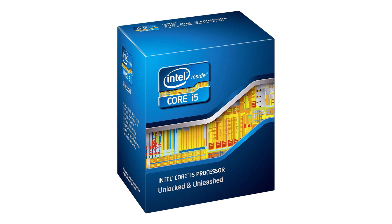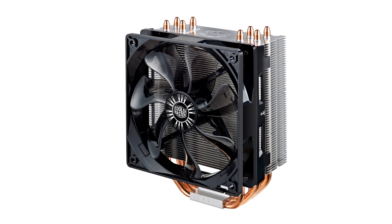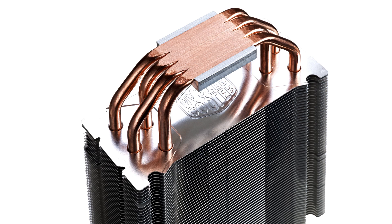Starting off with the CPU, I'm using the Intel i5-2500K. I've also got one of the 3570Ks — if you're not going to be overclocking and you'll be doing a lot of rendering and video editing, I highly recommend that one. But if you are going to overclock and play games, there's no sense spending the extra 20 bucks. The 2500K is a really awesome part. I'm also throwing on a Cooler Master Hyper 212 Evo — only about $27-28 — and that's going to allow us to overclock a little bit.